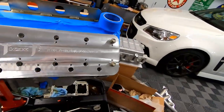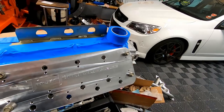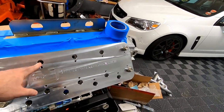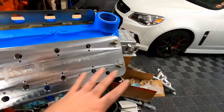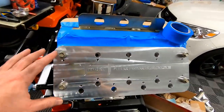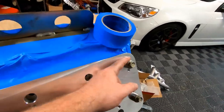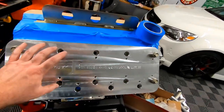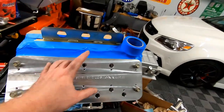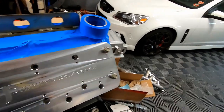And what we need to do to start this is actually measure the counter bore. We also need to measure the depth of the threads, and then we can go ahead and get started. So you guys can see I put the bolts all on the outside. So we're gonna start in the 6 bolts in the middle. And then when we're done here, we'll take these spacers and we'll grab our half inch studs. Then I'll put them on the inner 4, so here and here. And then we'll move the fixture and everything and start drilling on the outside bolts.